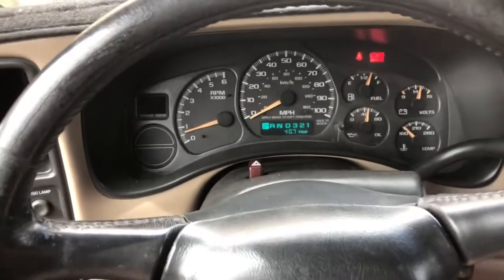I think it's the idle air control valve. I'm also replacing it because it's just an old part — about 20 years old, never been replaced. I took it out once and tried cleaning it with throttle body cleaner, which actually helped: the idle improved and the RPM wouldn't drop as much when turning. But now it's gotten to the point where cleaning isn't enough, so I need to replace it with a brand new AC Delco GM part.